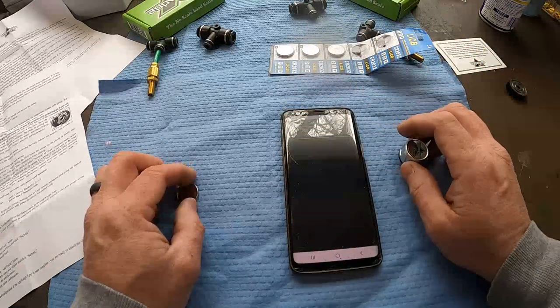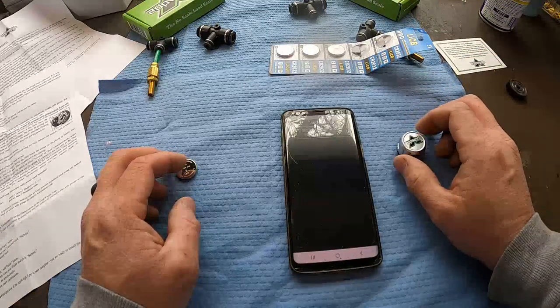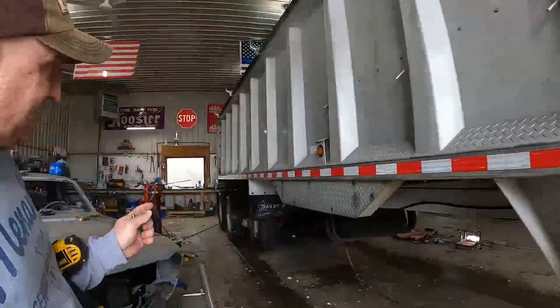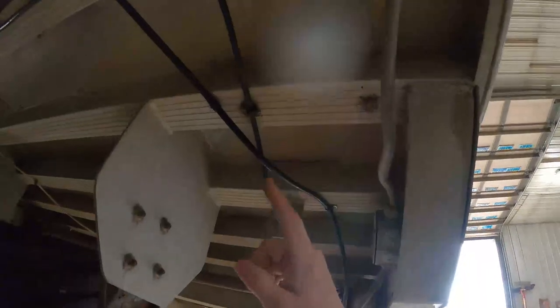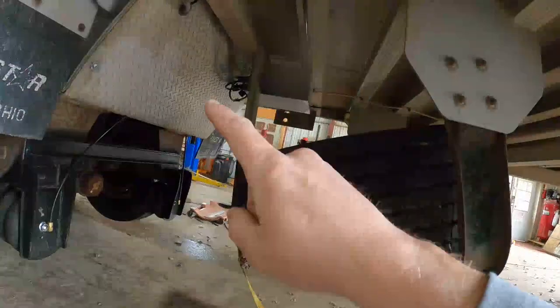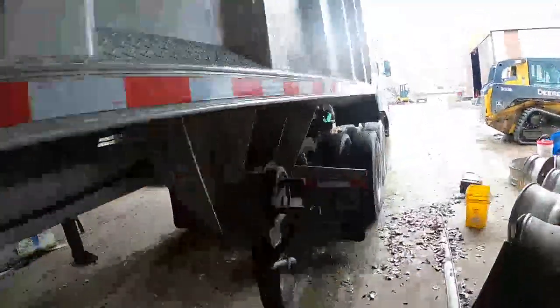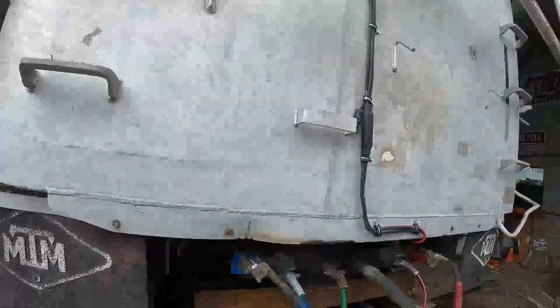Now I just need to install the actual sensors on the truck and trailer, then run to a buddy's yard to weigh the truck empty, load it, weigh it again, and get everything calibrated. Because this trailer is a frameless, I can't just run the airline down the frame. I'm going to run it with all the other lines and hook it to the draw bar, run it down the draw bar, and mount the sensor up at the fifth wheel plate — I'll drill a hole right here and put the sensor in right there.